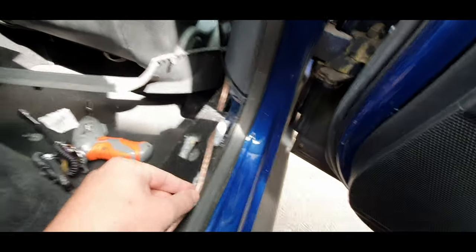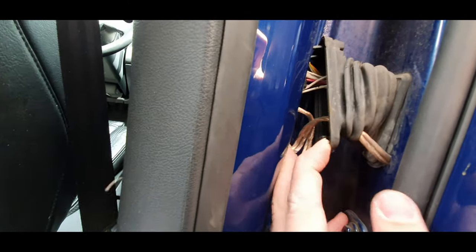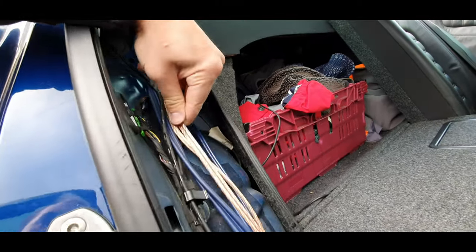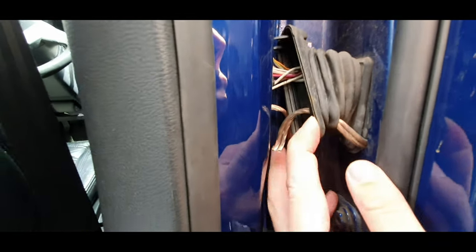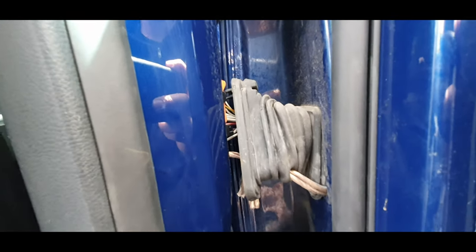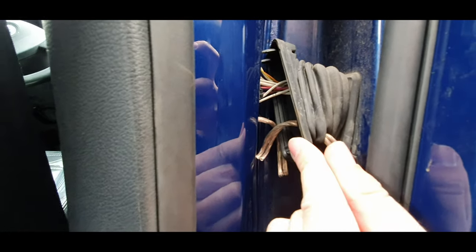I think the main reason why the cable snapped in the first place is because the wire I ran through was quite tight - there wasn't much slack, so it just snapped, basically pulled itself apart. What I've done is loosened it from the rear and pulled some through to slacken it off. It goes back up through there and then through the electrical block, which I've made bigger by drilling a little hole at the bottom - there were some unused holes in the electrical block.